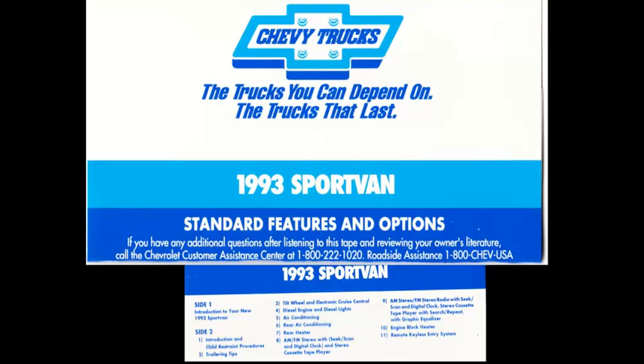Your anti-lock and conventional brake systems have two lights that monitor their functions: an anti-lock light and a brake warning light. The anti-lock light may remain on for up to four or five seconds when you start your vehicle — this is normal. If this light remains illuminated or comes on again while driving, the anti-lock feature may not be working correctly. If this light is illuminated, you still have conventional brakes. See your Chevrolet dealer for a system check. If the brake warning light remains illuminated or comes on while driving, carefully pull off the road. The brake light also illuminates if the parking brake is not fully released — check that your parking brake is fully released.